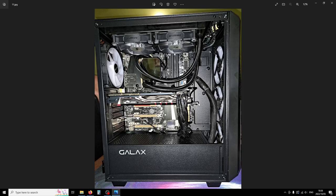Everything does fit relatively well — there's enough space for the front panel headers and two VGA cables to come through a single cutout in the PSU shroud and run straight up. The GPU support bracket isn't the best — it does bend — so it's okay for lighter cards. If you have a short, heavy card I'd suggest getting a different support bracket. The AIO cables do touch the GPU, but I've since adjusted the GPU position so it doesn't make contact with the backplate.